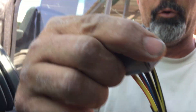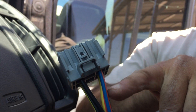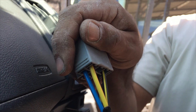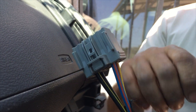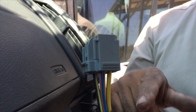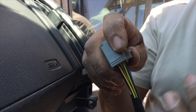The other harness you get in the plastic bag — there's a plastic bag with all this wiring harness in it — is a six-pin harness with four wires coming out of it. The blue and orange wire is switch number three, and the yellow one is switch number four. The trick on these two circuits: number three works when the key is on; number four only works when the engine is running — that's when that circuit closes. The two black ones are just grounds.